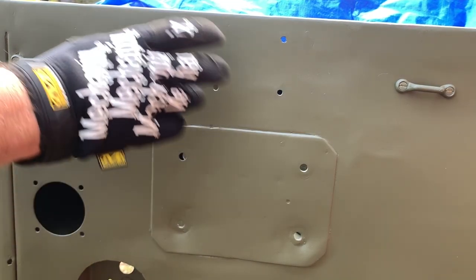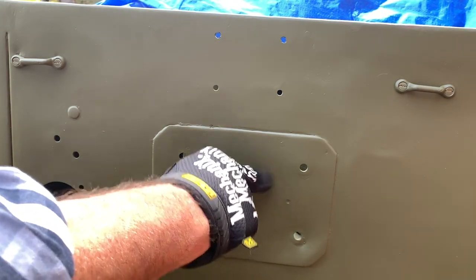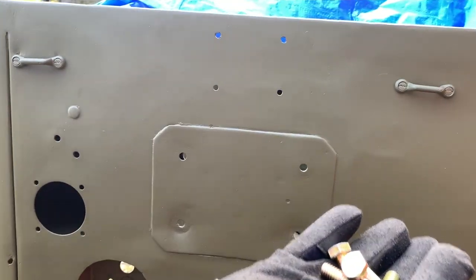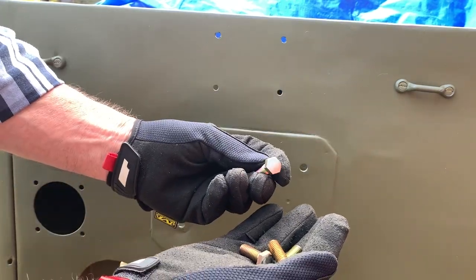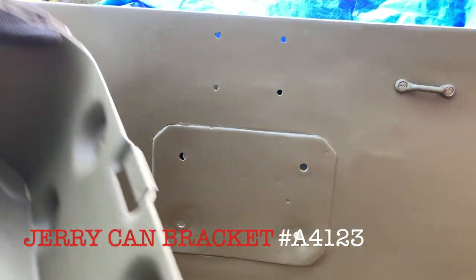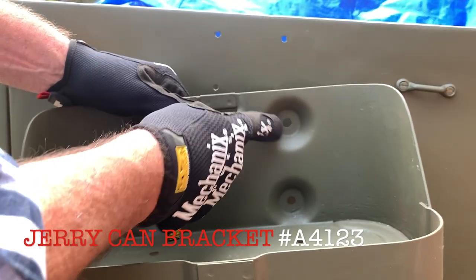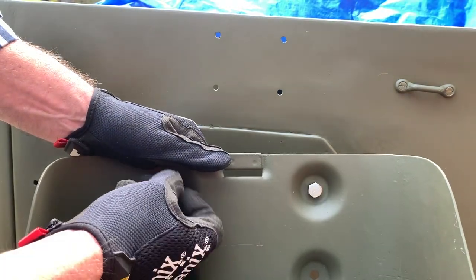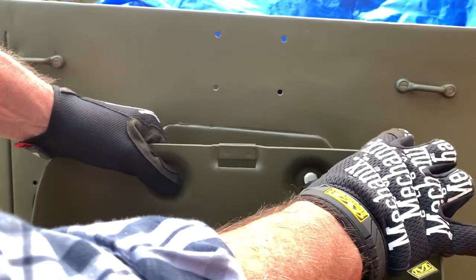The back side of the tub — it's the driver's side. You'll notice these holes here in this plate that's actually welded to the rear panel of the Jeep. That's to reinforce where the jerry can will go, and these top four smaller holes are where the strap bracket will go. I've purchased four new 3/8 by 16 by 1-inch long bolts and removed the markings off the head with the grinder, as I showed in previous videos — we don't leave the modern markings on there. I've got my jerry can bracket A4123, all primed and painted months ago and kept in a box.